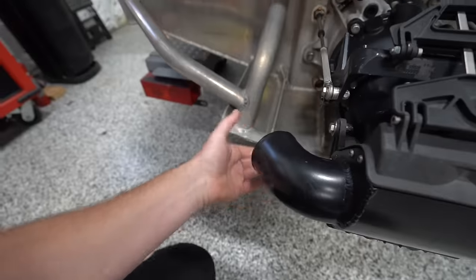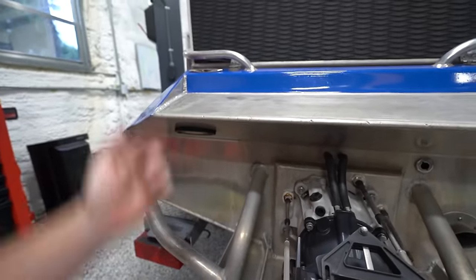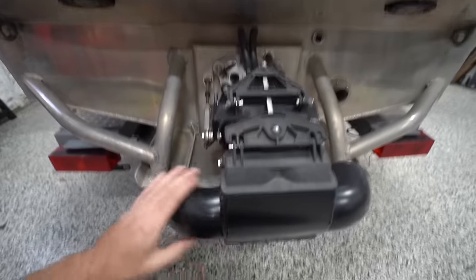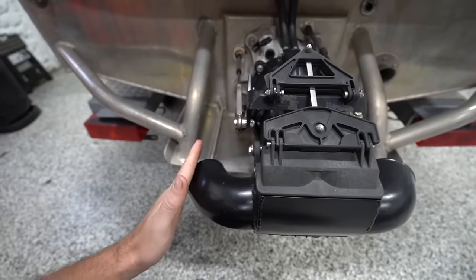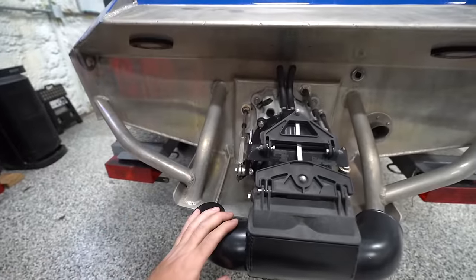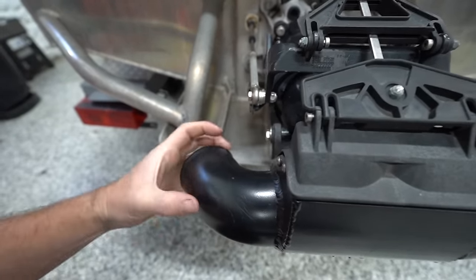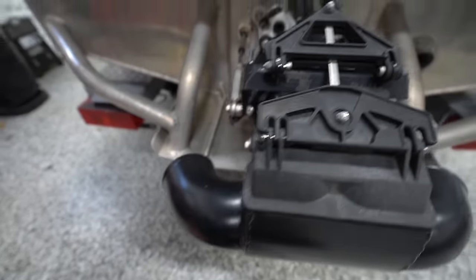these blast the water onto the skid plate, which blasted against the transom, which blasted up in the air, which blasted all over you. So at the moment with this reverse bucket, you literally pretty much can't use reverse unless you want to get wet. As soon as you put it down, water starts going everywhere. So we need to fix that. I think we can cut these off and just clock them basically down at the same angle that this is, and it'll solve that problem.